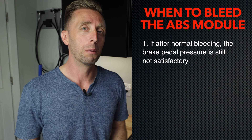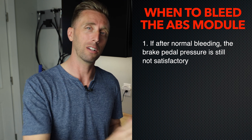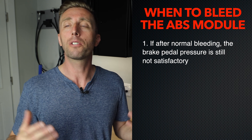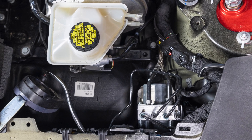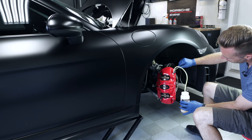Service manuals say you need to bleed the ABS module under two major conditions. Number one: after a normal brake bleed, if the pedal still feels a little soft or goes down too far, take the next step and bleed the ABS module — maybe there's air in there. The second reason is if you think air got into the system, usually from changing parts ahead of the ABS module like the master cylinder, or if you removed brake lines to the ABS system — that will definitely introduce air. When you work with just the calipers, generally you won't get air all the way back to the ABS module.